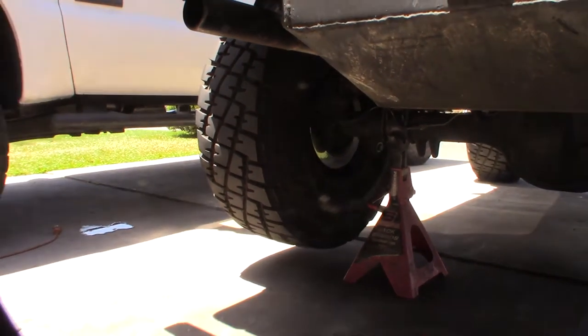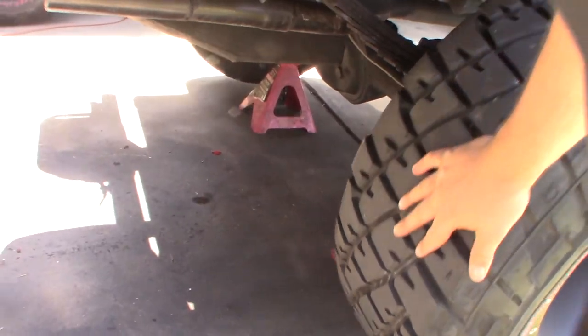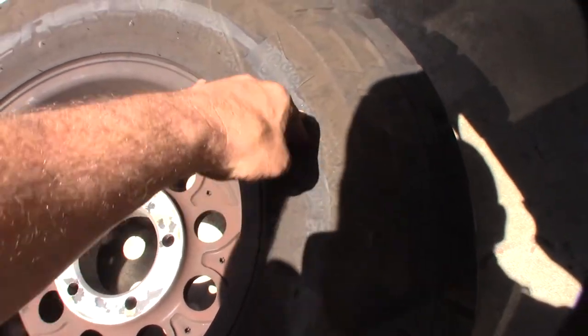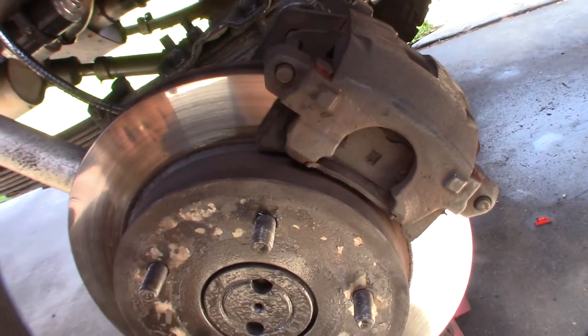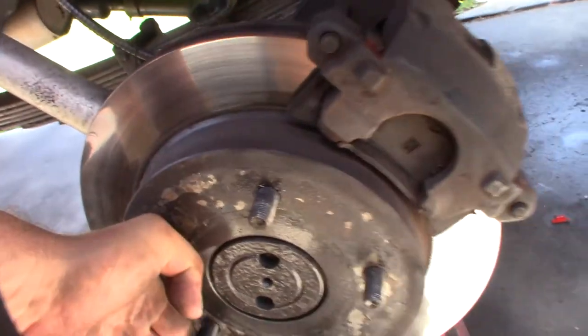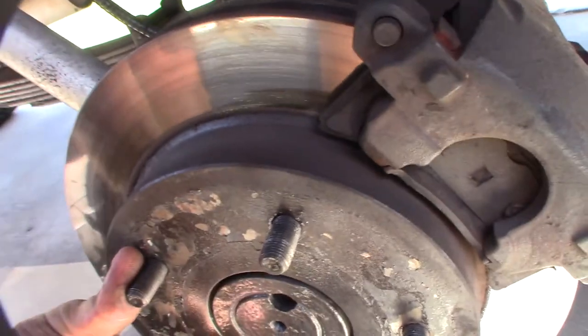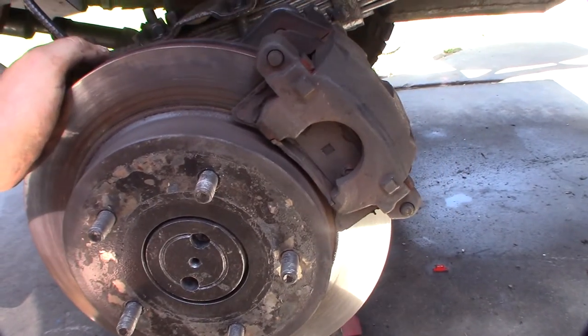I wasn't even expecting to see that. As you can see, I basically have no e-brake — it's barely enough to stop the car. Look at that tire damage — it's not too bad, but it could definitely put a hole in the sidewall eventually. The cable was rubbing against this right here. I'm about to zip tie it higher. Right now it's fully engaged inside the car, but I can turn the tire with one hand — it should be totally locked up and not turn at all.